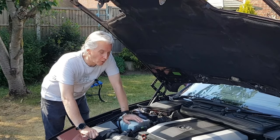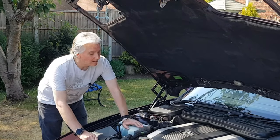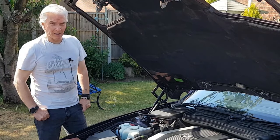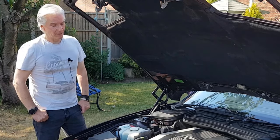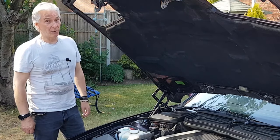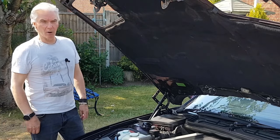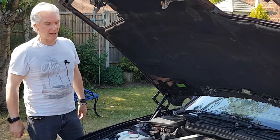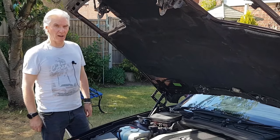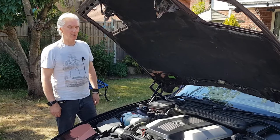Now, the funny thing is that in 2020 there are a lot of M62s failing, and they're failing quite early as far as mileage is concerned. We're having ones failing at 60, 70,000 miles, and that's not great. But then you have engines like this one, which is over 170,000 miles on the original guides and doing fine. So there's got to be a difference between some engines and others, and there is a big difference. There's really two things which affect the timing chain guides, and if those two things are looked after properly, then the engine's going to last a lot longer.